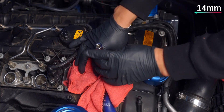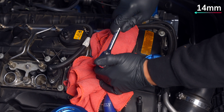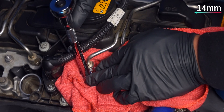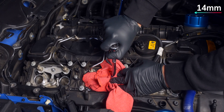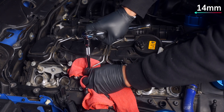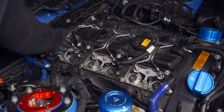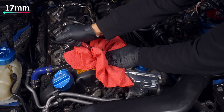Go really slow on the first fuel line and hold a towel over the nut in case the system is still under pressure — this one should leak out the most. You can address the other five a little quicker once the pressure is released. Expect some fuel from the others, but not nearly as much, so continue to cover up the ports. We don't want gasoline pooling here, and definitely don't want it in contact with the rubber boots of the ignition coils, as it will chew right through them especially under operating temperatures. Once the six lines are loose, loosen the 17mm of the main rail and use towels to catch the fuel.